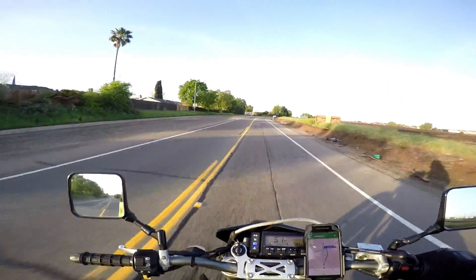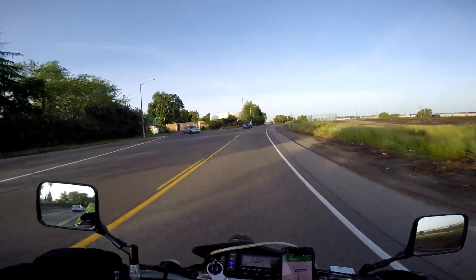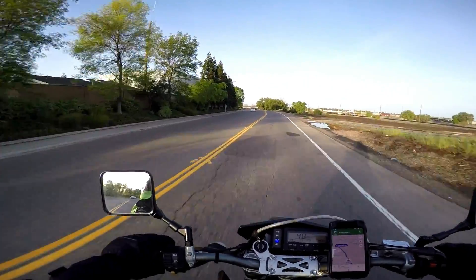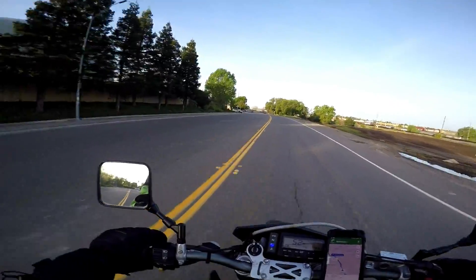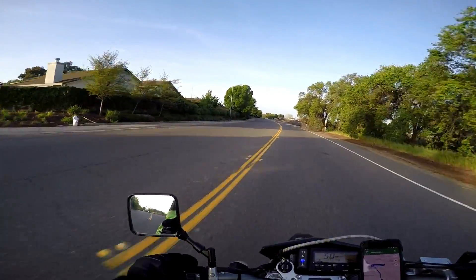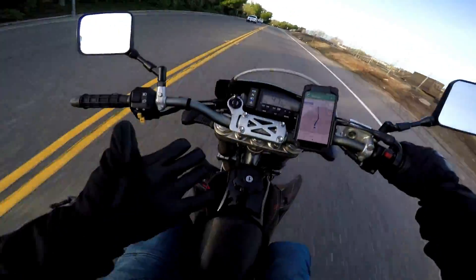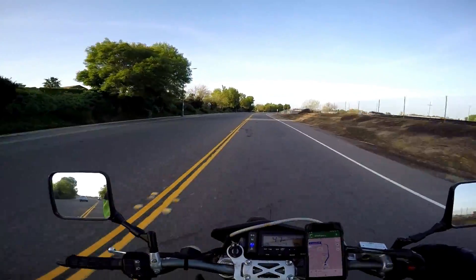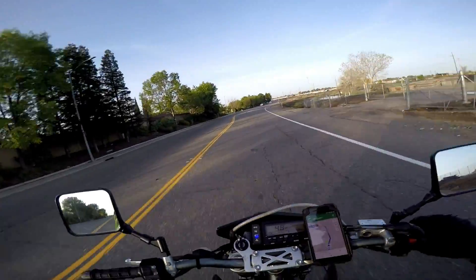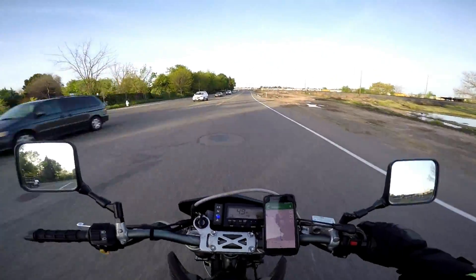They do have some mods done to this bike and I was actually pleased that they did. There are a few standard bolt-on mods: the three-by-three mod, which is just an airbox mod, jetting the carburetor — yes, in this day and age this bike still comes from the factory carbureted — and an aftermarket exhaust. The bike just sits and doesn't hesitate at all, it just goes.